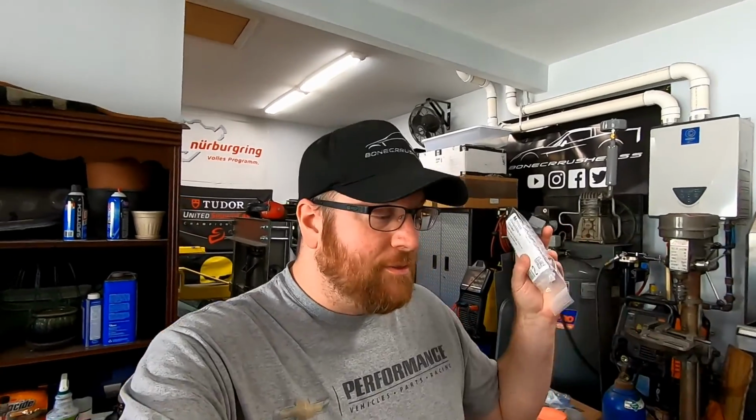Earlier in this video, you remember that we had to install that fuse box. Well, we had to remove this gray plug. Well, on the truck side of this plug, we actually need to add 3 pins. There are 2 ways that you can do this. You can either buy a pre-terminated, 6-inch length of wire with the pin in it, or you can go ahead and buy the pins yourself.